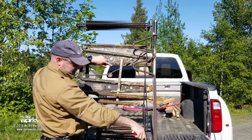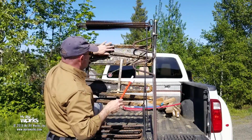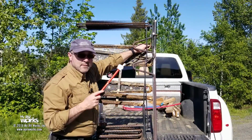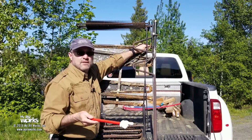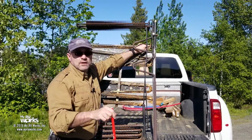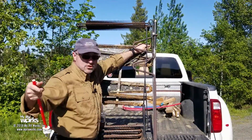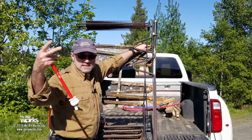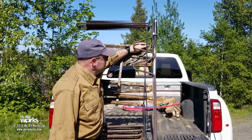It just came through a boiling process, just went through vaporization. So it's hot, now we're starting to cool it down. Right here, we have a pressure differential, where that ammonia is going through a small tube into a larger tube. Remember that pressure cooker analogy I gave? Inside the pressure cooker, it's all liquidy, but as soon as you flip that vent and go from a higher pressure state to a lower pressure state like my kitchen, the water vaporizes and stinks up the neighborhood, which is yummy. So that's what's going on right here.